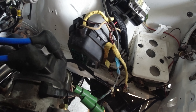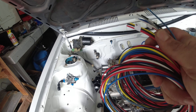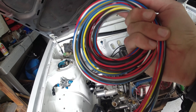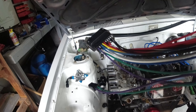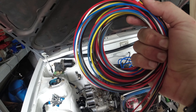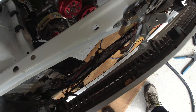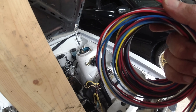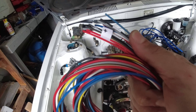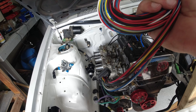This is a lot of wiring for that little box, but every one of these wires has a home. Pertronix labels them - this is hot, permanent hot, this is permanent ground, and then all these other sensors go to things like the igniter or the tach. I'm going to jump into the instructions and see which of these I need and which I don't - maybe I can get rid of some and make a nice harness. I know one has to go to the dizzy, one to the igniter, one to the battery, and one to the tach.